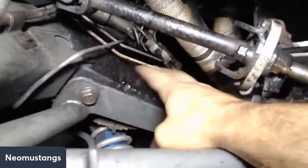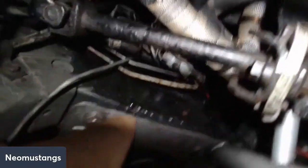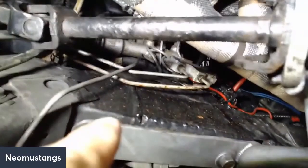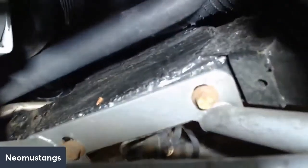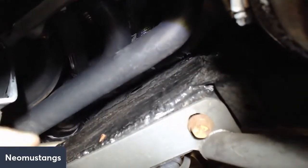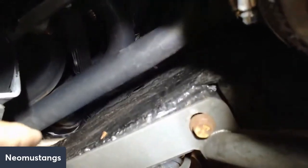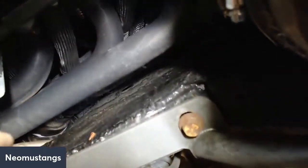What happens is they all get beat up over time here. Break, and you can see my proportioning valve's leaking a little bit from the weep hole. That is why that one rots out faster. If you go over to the passenger one, I fixed this one too. This car had a bad AC setup, and this panel here gets hot and cold all the time, and the condensation from the actual AC will make that rot out.